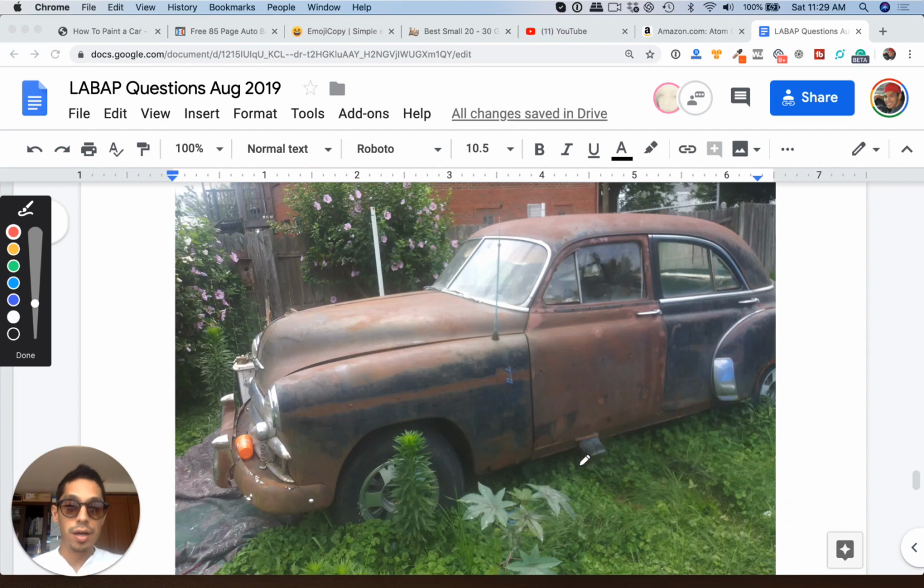The second way is to paint the body only one day. Okay, wait a week or 2 or whatever, and then do your interior paint job, right? Of course, you're going to have to mask and make sure you don't get an overspray. The third way is to do your interior first, right? And then wait a week, a day, or whatever time frame you got. Mask up your interior, your door jambs, and then paint your outside.